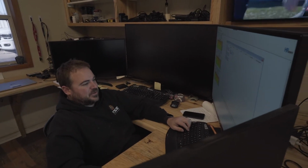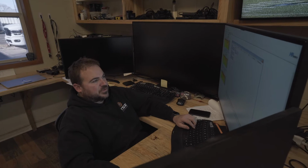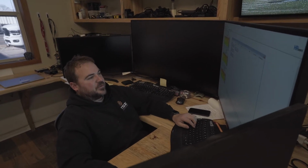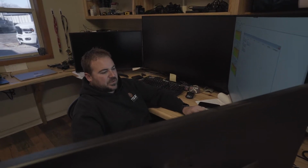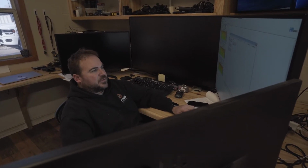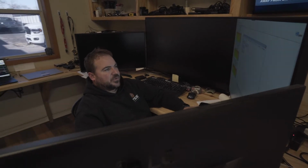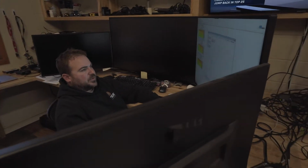Customer with the 2020 Raptor that put extremely large turbochargers. They replaced the OEM turbos with some pretty big turbochargers, and the ECM struggles to richen the truck up quick enough to prevent a whole bunch of knock retard from coming into the ECM and then retarding timing further, and it ends up making lower power than what it should. So we're just modifying the ECM contents to be able to change the state at which the engine starts to deliver fuel to the motor, so it doesn't lean out so quickly. That's one of the things we're doing.